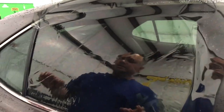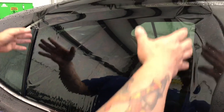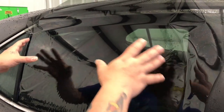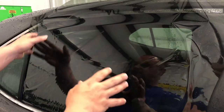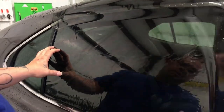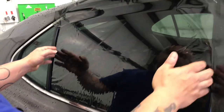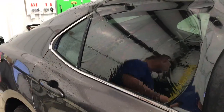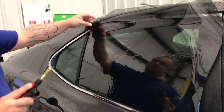What you do not want to do is come over and cut the other side right away. It'll cut your window tint perfectly to where it just fits the window — but it will not give you access to move your window tint left or right. You don't want to cut that second side because it'll be too perfect and you won't have any wiggle room left or right.